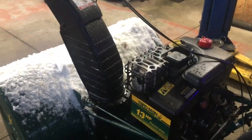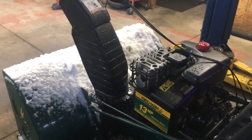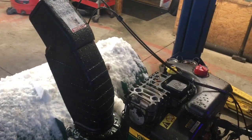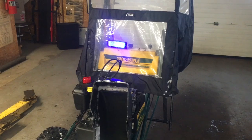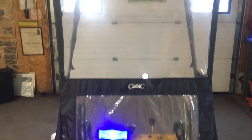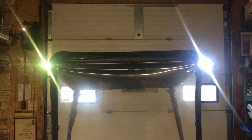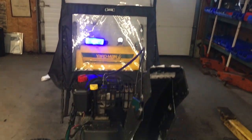While you're turning, your chute turns with you. When you pilot the thing, all you need to do is press a toggle switch. There's a light on the thing, and some of the better variations had a heavier lighting coil on the motor — essentially an alternator — to charge a battery. I got a battery from a little Amigo hospital cart and hung it on the side. I put a diode in series so you don't spike the alternator, to run that power window motor. As an afterthought, I made the factory console light blue — pretty neat at night.